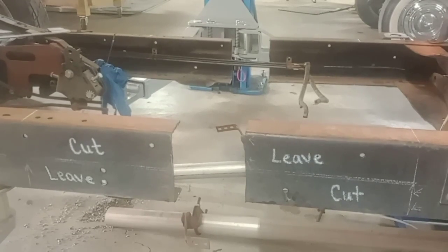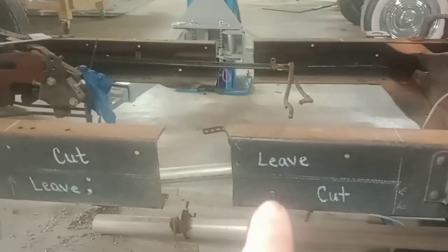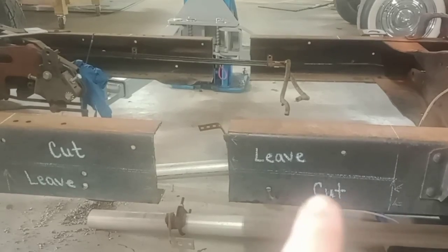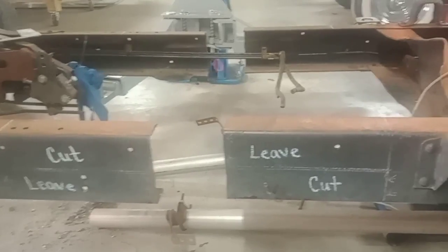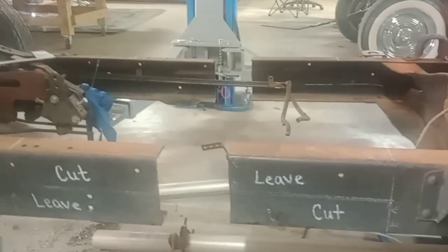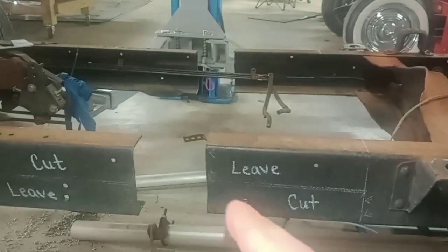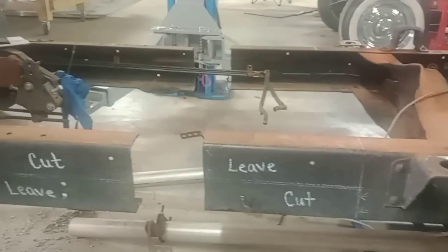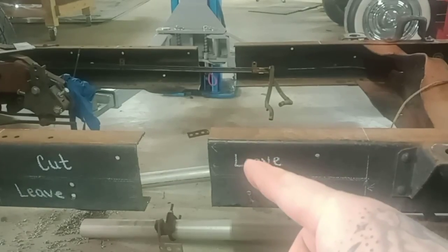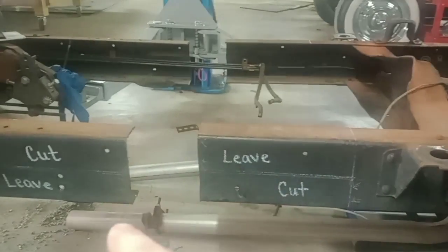But like I said, 2 inches over, measure 12, 24, make your marks, measure halfway down the frame, it should be around 3. I make 2 lines here as you can see, and I cut right in between those 2 lines. I go a 16th over and a 16th, and with my speed square, I got a little adjustable square so I can adjust it up and down, and I make 2 lines and I just cut right in the middle of those. Now as you can see, my frame's a little jagged here. Well, you see my arrows, I want that right on, so you know you got a 16th disc on that grinder. So like this right here, I cut to the other side of the line, right on the back side of the line, and then over here you can see how it goes like that.